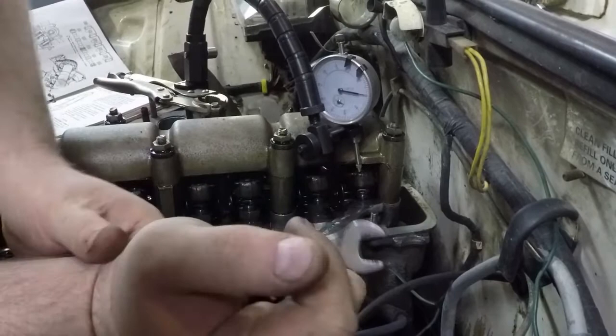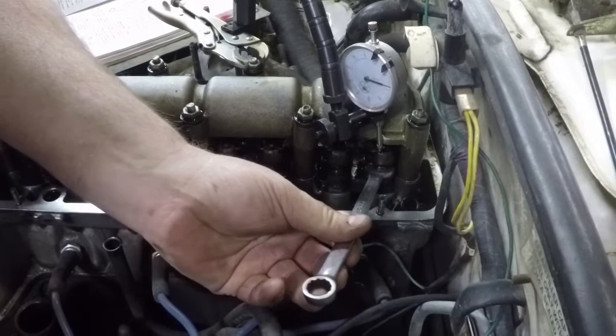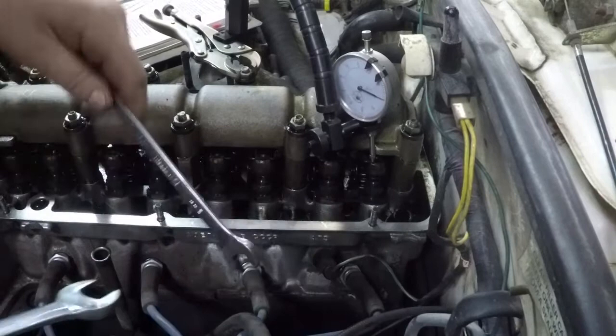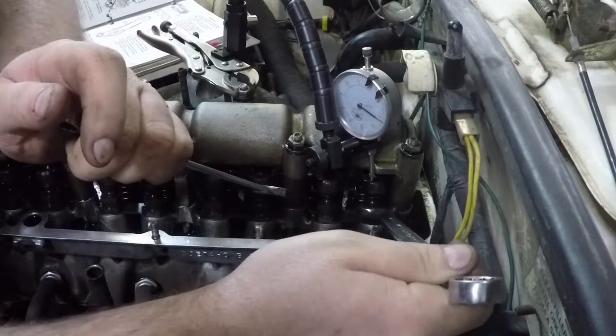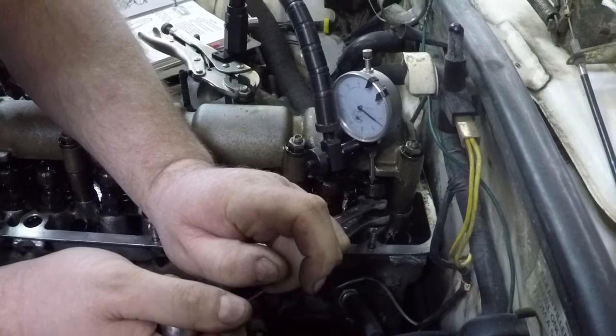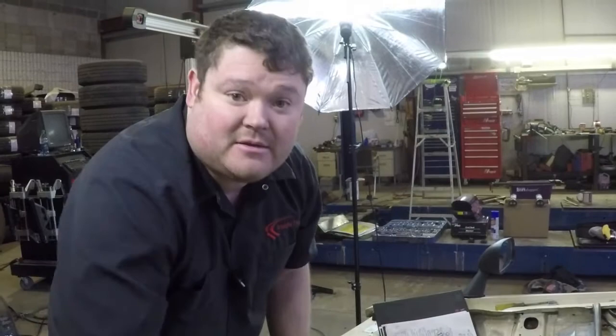I have my 13mm and my 17mm wrench so we can adjust the rocker. Get the wrench down on the bottom one — that's your main adjuster, and they're always tight. With that loosened, we can adjust it and actually get an idea of where we're going just by watching the dial indicator. Now that we've come up about three thou with that, we tighten it back down. It's a bit fiddly and sometimes it'll take a couple of adjustments to get it exactly where you want. Make sure you have it tight, because you don't want it to come loose and back off — that has happened once.